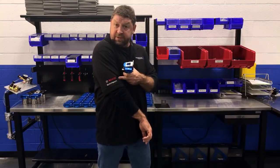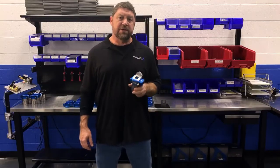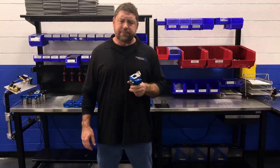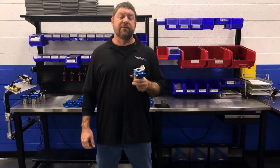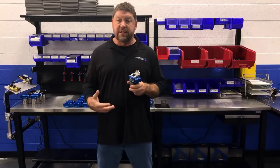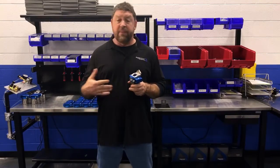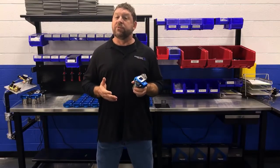Not surprisingly, these guys right here — imagine that. They provided the specification for protection of electronic fuel injectors, stating that at 35 microns the filter had to have an efficiency of 100%, which means no particle larger than 35 microns should ever make it through the filter to the fuel injector.